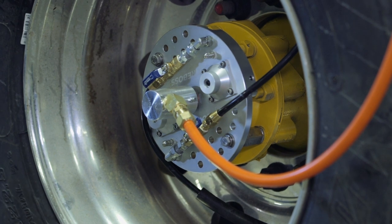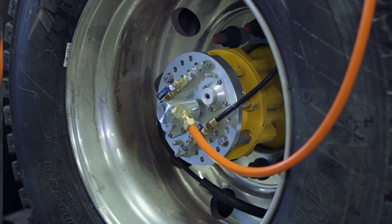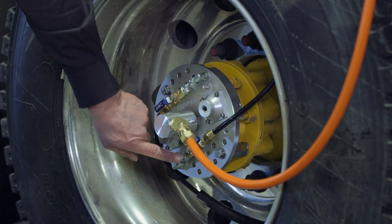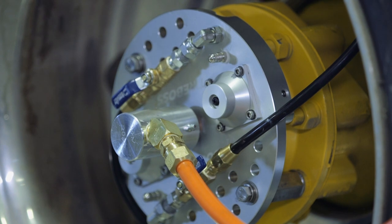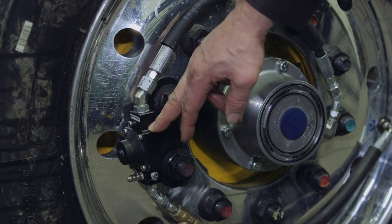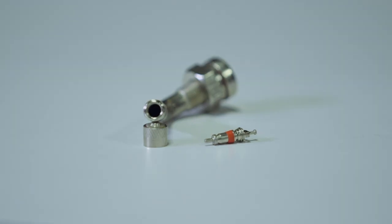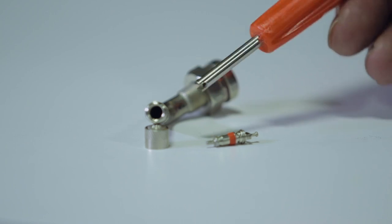There are various configurations of these wheel end valves — either built into wheel disc assemblies or individually mounted as required. A Schrader stem allows for individual tire pressure testing or filling. If these wheel end valves close off at 20 psi, they need supply air pressure again in order to reopen. The individually mounted wheel end valve also has a Schrader port to supply air or check individual tire pressure. Please note there are no valve cores in the valve stems, as air must pass both ways for tire inflate and deflate — ensure valve cores are never installed when servicing tires.